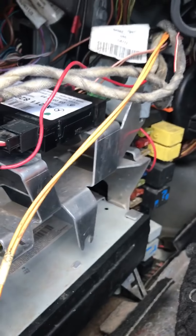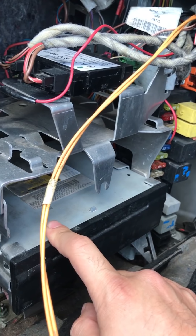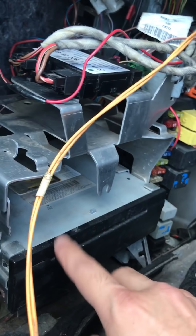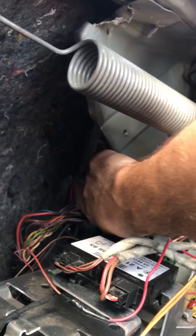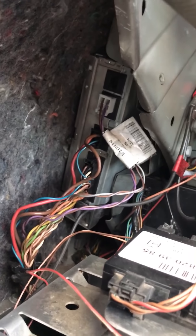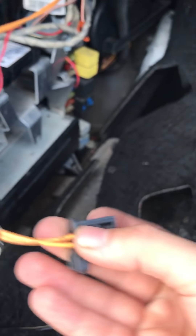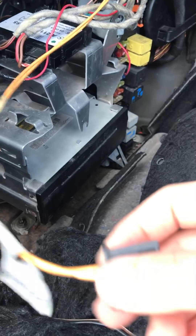So this is in the trunk. This is the navigation system right here. If the navigation system is bad, we have to check it first, or check the GM module in the back — the audio module, the gateway — it's all the way in the back. The easy thing you can do first is buy a fiber optic bypass wire from Amazon or eBay. This is all the fiber wires. I took off this fiber wire because my problem was already with the navigation system and I had to figure it out.